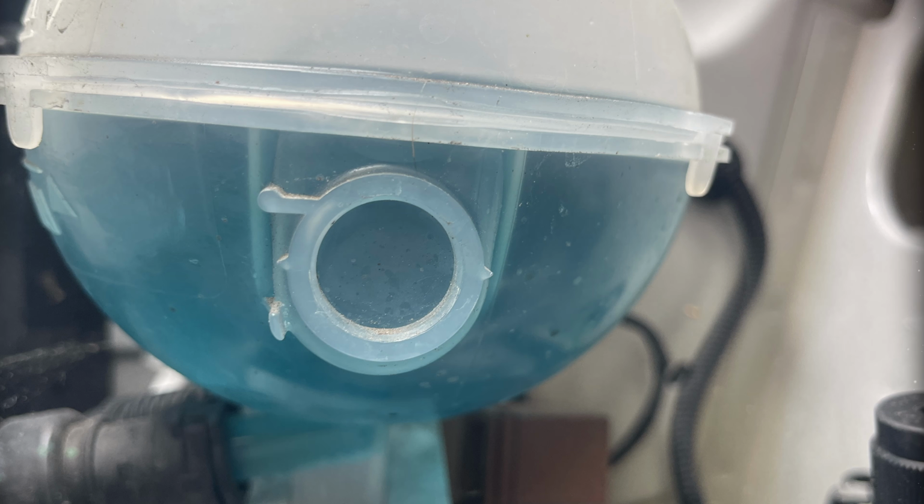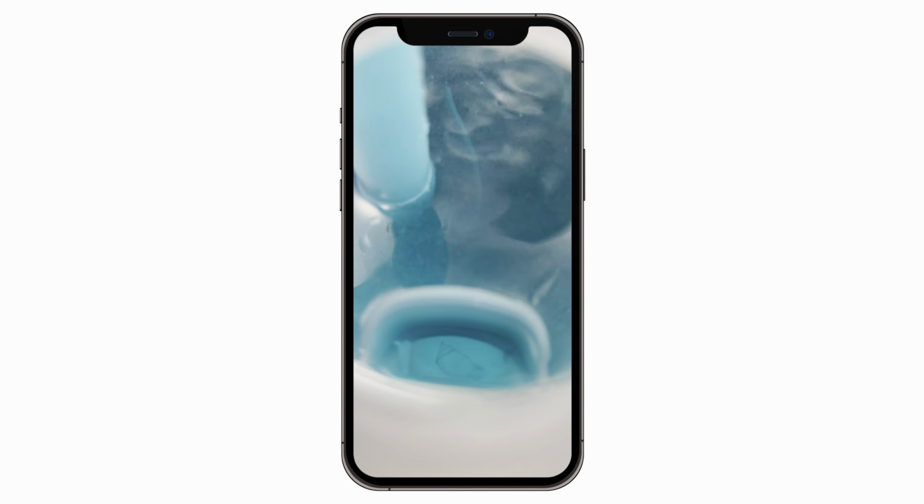This is then a good time to check your coolant reservoir. You can see there's bubbles from where the small amounts of air is making its way through the system with the ignition on and the pump running. As I said earlier, if you were to replace the battery or were to allow a lot of air into the system, you would need to vacuum bleed it. So that simple preparation beforehand avoided a whole other job. Well done you. I mean, most people aren't going to do this job, but thank you for watching.